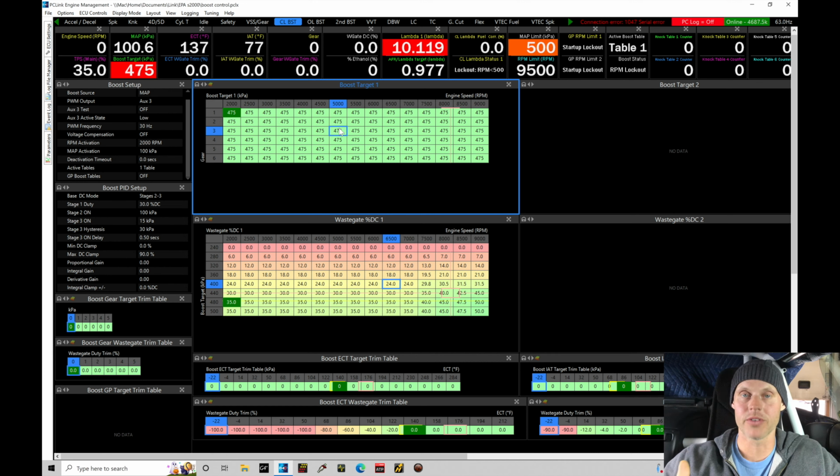I'm not gonna go much higher than this, even though we probably have more adjustability range out of the turbo. That requires us to increase the base fuel pressure, going up another 10, 15, 20 PSI base pressure. We probably could keep going with this, but this is a decent amount of boost. I wanted to get up to about 55, 60 pounds. So if we're right about there and we're still good on the fueling, we're not gonna worry about touching the base pressure. We can race it, figure out where we're at, and always adjust it as we need at another point in time.